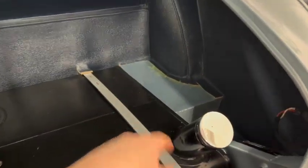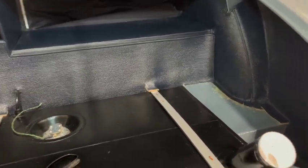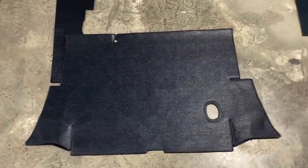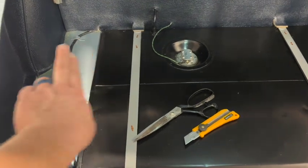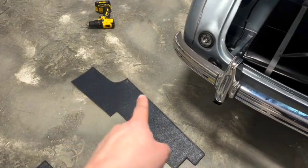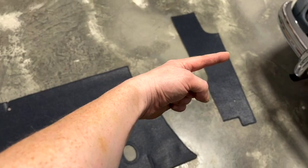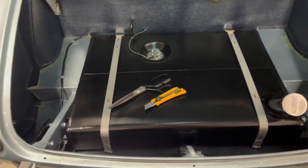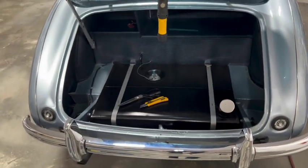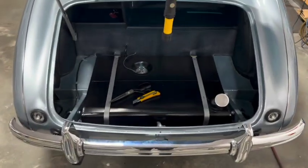Finished off with the proper battery switch tag as original. The early BN1 has a different style boot mat and side mats than later BN1 and BN2. The early BN1 mat is not full width at the top — it just covers the gas tank and stops about there on either side, and then you've got these long side pieces to finish off the whole side. The later style mat is actually full width at the top, and those side pieces only have to cover the lower floor pieces. These early long ones have to do the whole lower floor piece and cover the entire upper area too — that's an early BN1 upholstery difference that was later changed probably around summer 1954. I'll go ahead and put those in and that should finish it off.